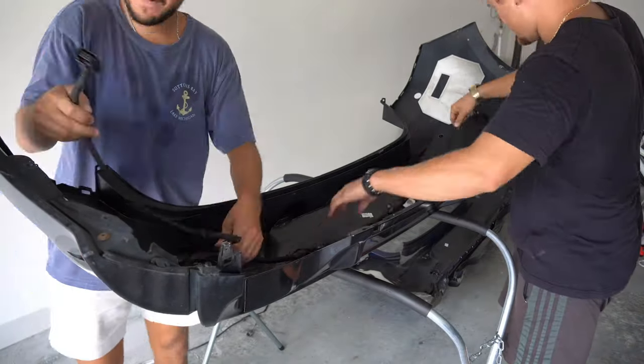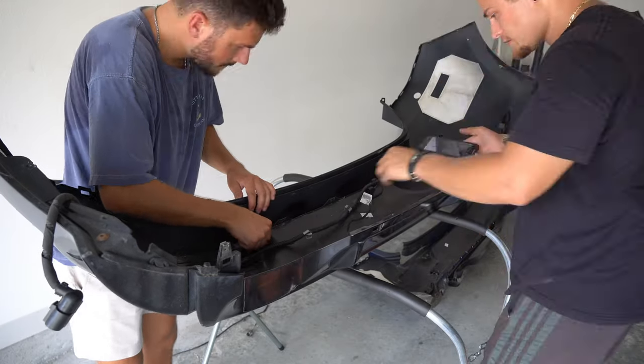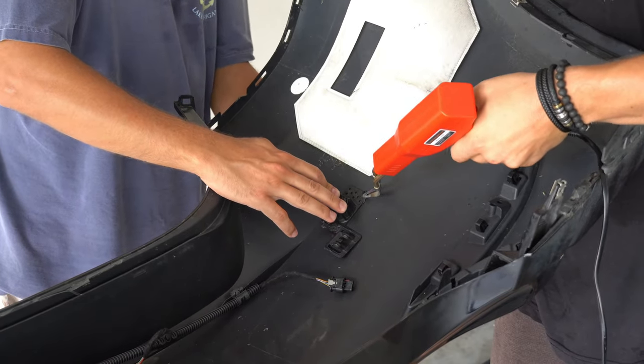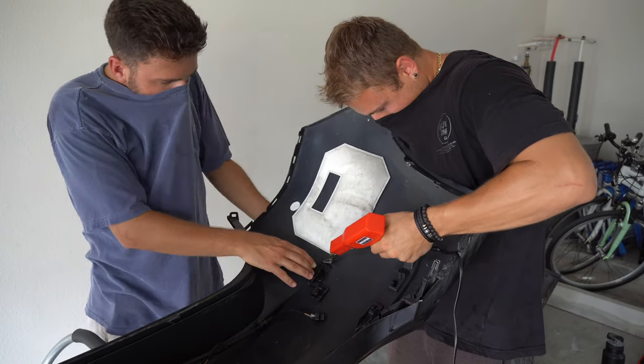After making sure the wiring harness aligned properly, it was time to plastic weld the brackets to the donor bumper. Sean was able to hold the sensors flush with the bumper so that I could plastic weld the brackets correctly. I also used a fan to blow the smoke away, as I'm sure nothing good comes from breathing in this junk.